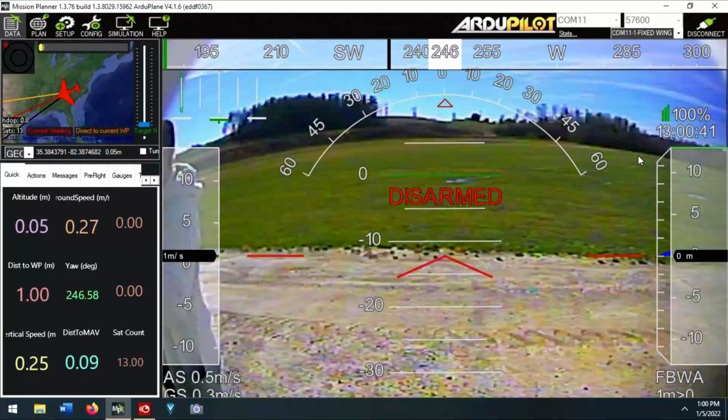First thing. Then I turn to the pre-flight checklist. And then, of course, get out the RC radio. There's no flight battery on the platform at this time, so there's no need for the radio to be on yet. If I have to put the antennas on the transmitter in the back of the TX16S, you know how that goes. It's going to take some time. But that platform is sitting there warming up, gyros and accelerometers, getting this board up to temperature, and especially the GPS for locking up satellites.